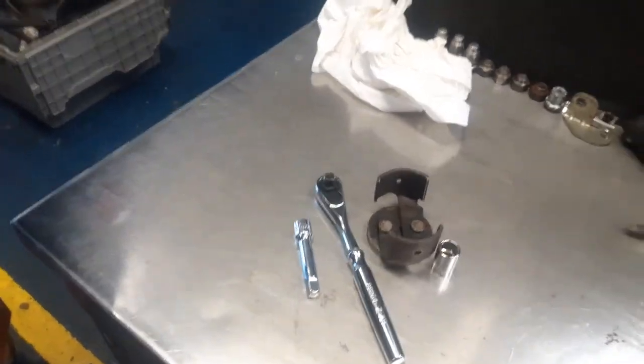The first thing I'm going to do is release my drain plug. So for the drain plug I was wrong — it isn't 14 millimeters, it was actually 13 millimeters. I went ahead and released the drain plug, loosened it up. Lefty loosey, righty tighty. If you look here, I'm going left with my ratchet.